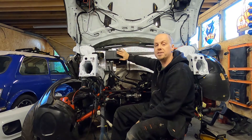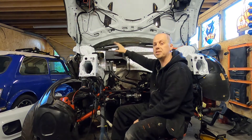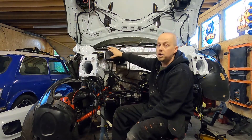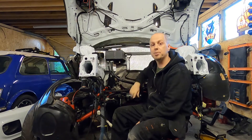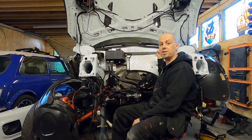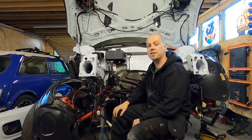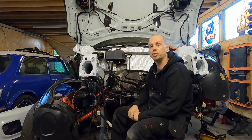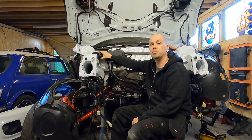This is an aluminium Canton can, and what I chose to do is make up a power steering tank welded to the side of it, so I've got an all-in-one power steering and coolant tank. I appreciate lots of people watching this can't weld, so other companies offering turbocharged conversions take the standard power steering tank and locate it up at the top where the alarm is. This is a right-hand drive — if you've got a left-hand drive you'll probably want to do it over this side next to your brake booster. Our brake boosters are behind this firewall section and there's reasonable space there if you take the alarm module out. I'm keeping my alarm module where it is and keeping my power steering tank over here — this is a pre-facelift and it still fits in with plenty of room.